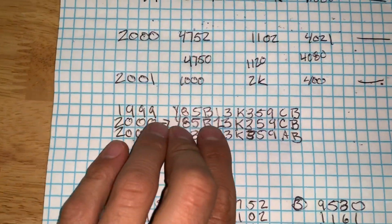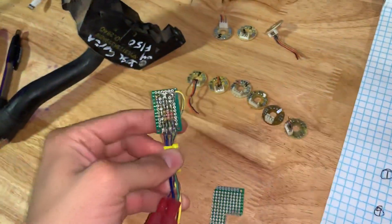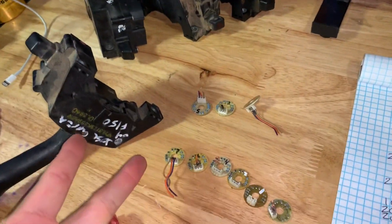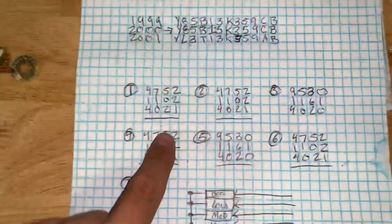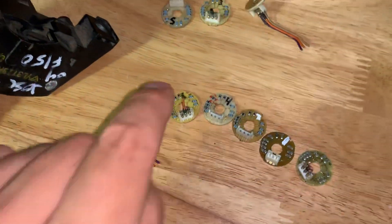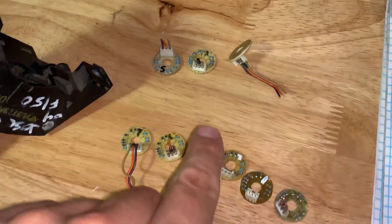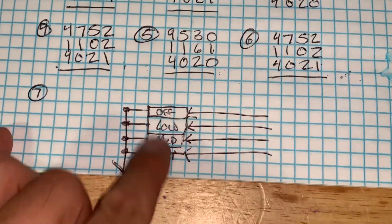99 and 2000 have the same part numbers, and 2001 has its own. With that being said, the wiper doohickey works differently — my 2001 doohickeys do not work on 99 or 2000s. After testing and investigating the older ones, you can see the 2001 ones here and the 99-to-2000 ones here. The resistor sizes are clearly different; they are not the same.